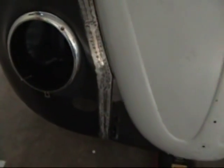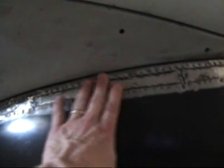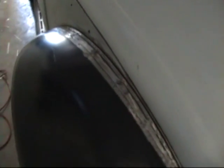Got a couple more little panels down there and a few more here in the front. On this side I've already finished — pretty ugly looking — but it's all the welds holding all these little pieces in place. Once I got it all welded, I took the fender off to weld it all up, then came in with a hammer underneath, mounted it back on, and pounded everything up so it's pretty straight. Probably have to touch it up just a little bit more before I put bondo on it, but it comes down through here nice and smooth, rounded off and matching down here at the bottom.